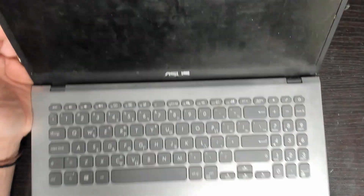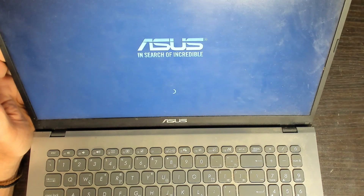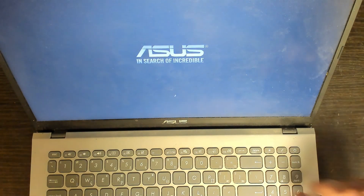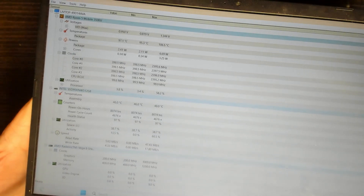Let's just power on the laptop. Windows is loading. The machine is very dirty — I can see that on the screen and around the keyboard. Already, without running any software or apps, we're hitting around 100 degrees Celsius; in fact the maximum will hit 106. This is a Ryzen 5, so the machine is definitely overheating.